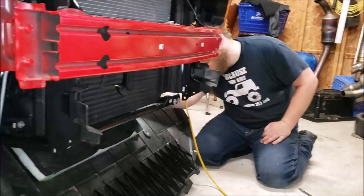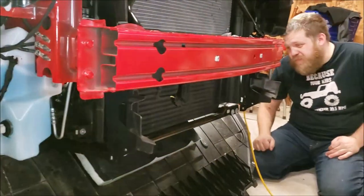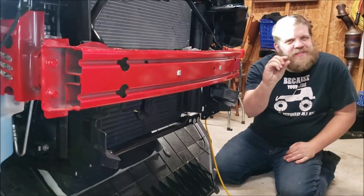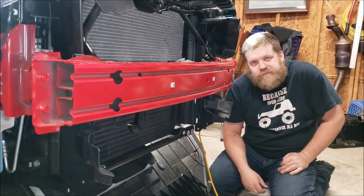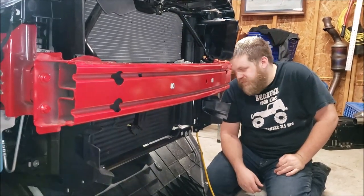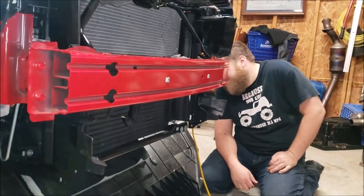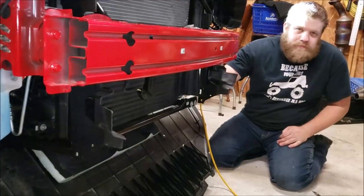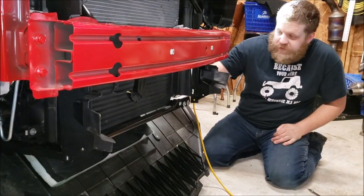Yeah, so it's this one. It's not as far down as it can go, but there's like an eighth of an inch. Well, worst case scenario, come back and change it for some T-bolt clamps. I did put those on. Then you really don't have to worry about it. The OE clamps will run 20, 25 pounds, give or take. No issues.